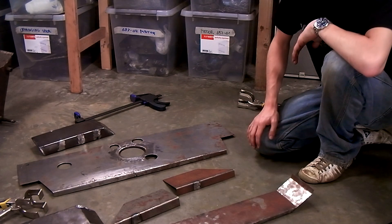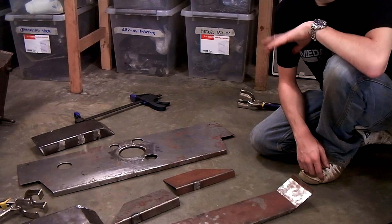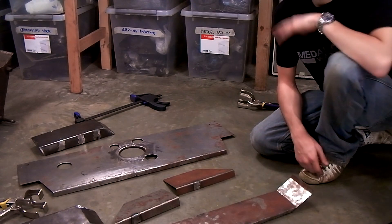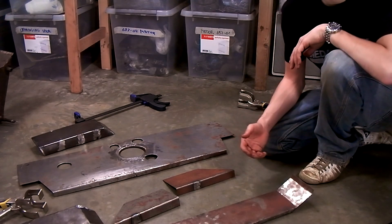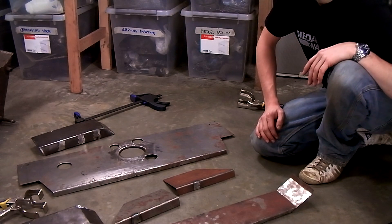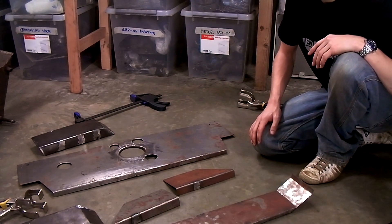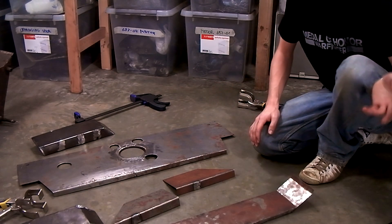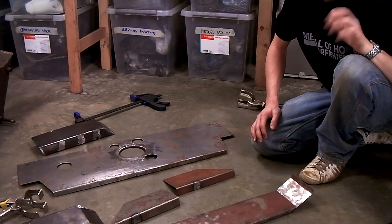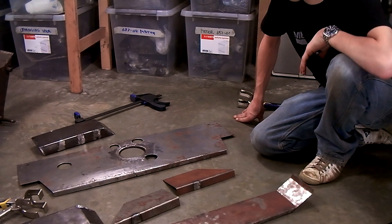I'd like to give you a little bit of advice: I wouldn't use all the chassis plans on Jerry's website to build a Series 1 front T-section. You can use them, but I wouldn't trust the dimensions because I used the plans but double checked all the measurements against my original front T-section, and some of the dimensions were quite far out. The width was different and the height was different. So I just double checked all the measurements constantly, used the chassis plans as a bit of a template, and used my own dimensions. That way I'm sure it all fits and complies with all the original dimensions.